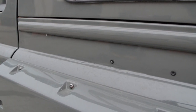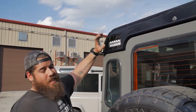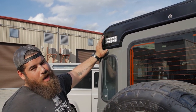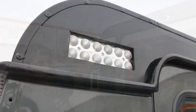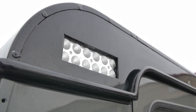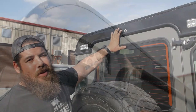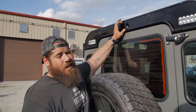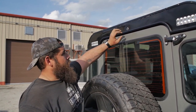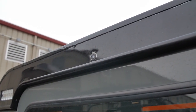Now walking to the back — we do LED spotlights in the back, but here you can see they recessed them into this panel. There are a lot of problems with this: you have water leakage, wind noise coming through, and it's not the proper way to do it. We usually mount them on the outside; it looks a lot cleaner. They also put a camera where the rear washer should go. We usually mount our cameras down here, out of the way, so it doesn't look like it's there.